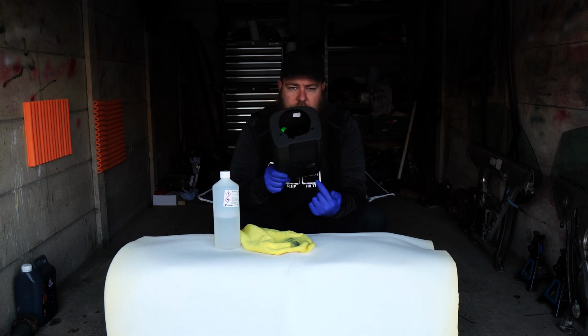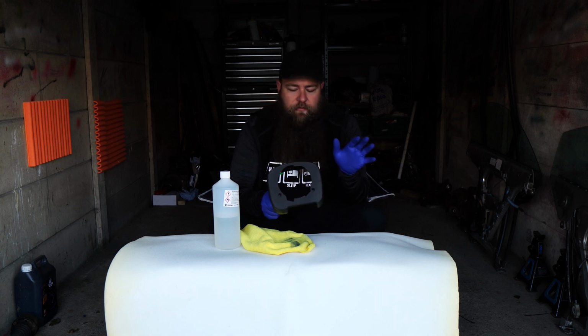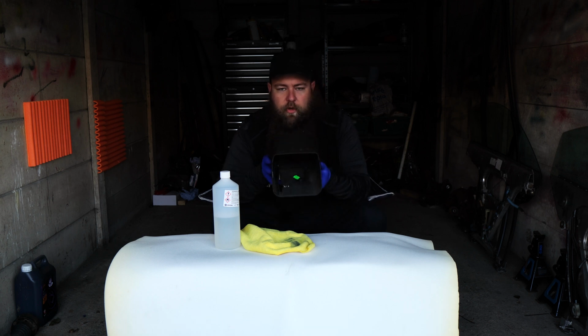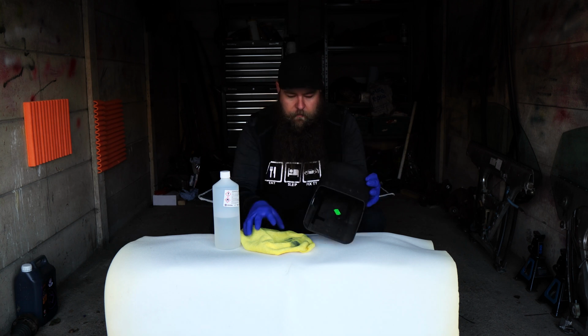You also have to take the rubber handle off of the release here for the steering column. But you can get away with this fully: you can just drop the steering wheel down and pull it as far forward as you can. Then you'll get everything that's visible, and then you can just put it back to its normal fixed position, and you won't even have to take the steering wheel off, and everyone's a winner.